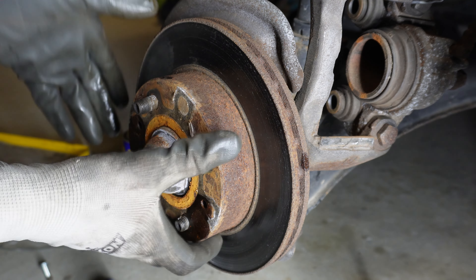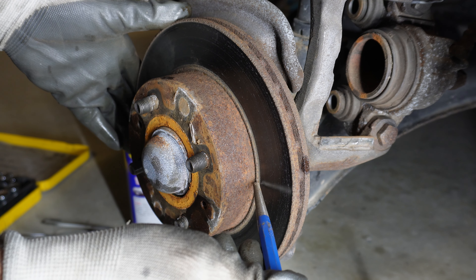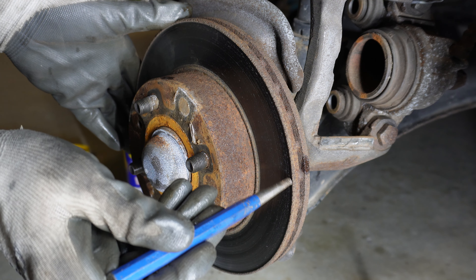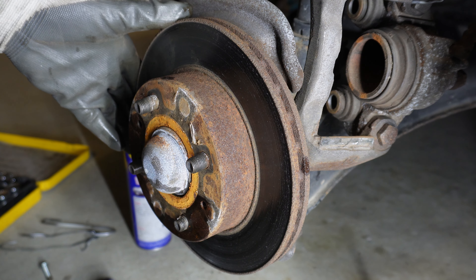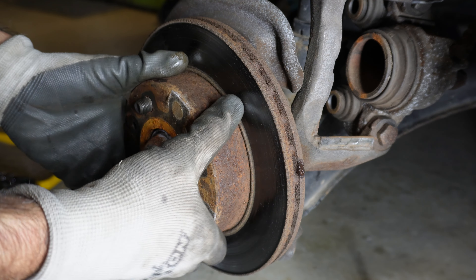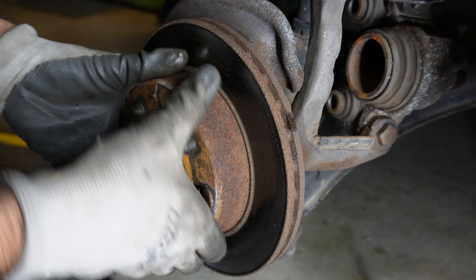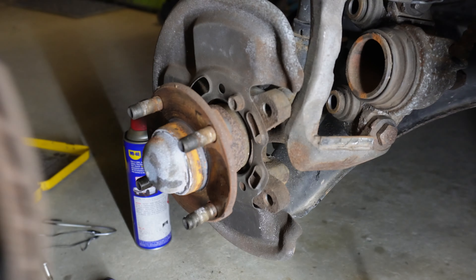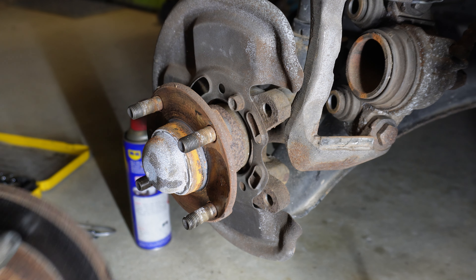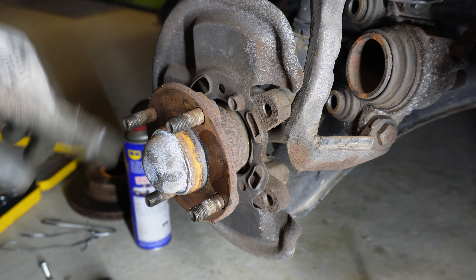You might be able to see the reason why I'm changing this — the actual disc face here is worn down quite a bit. You've got the edge there at least a few millimeters in, and the pads themselves are literally on their last legs, they're just way too thin. The thickness — it's worn way too much to be able to machine it, so the best option was just to get new rotors. You can see this side too, it's worn right down.